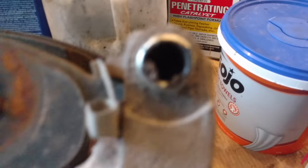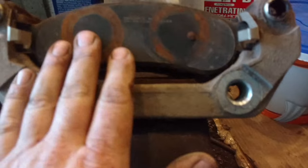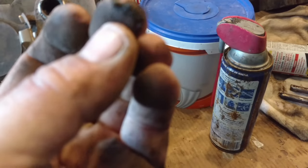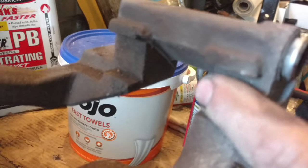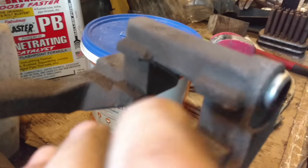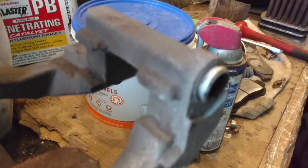I'll show you how I do that. The brake pads can't move because there's rust that started on this slide in here. We're going to knock these pads out, clean the backs of them up, clean the slides up where the pads go, and clean up the caliper slide — whatever was in there turned hard. Here you can see it's filled full of crud in both places. A lot of guys like to use a wire wheel to clean this up, but I don't, because in a lot of cases all they're doing is shining up the rust — it doesn't take it off.